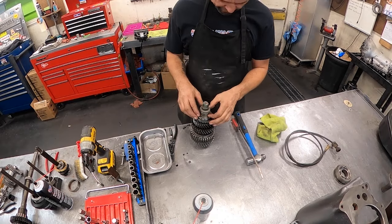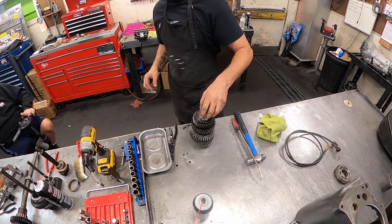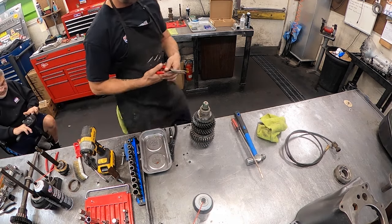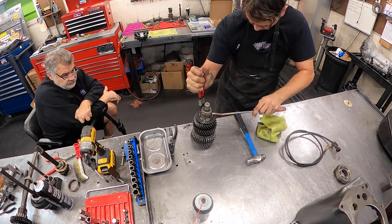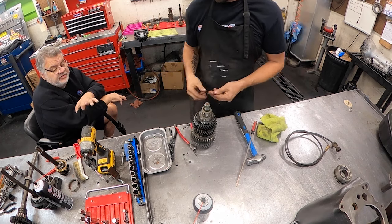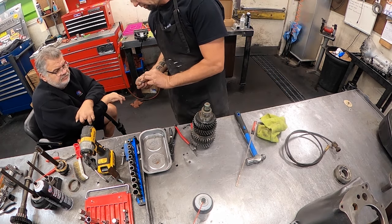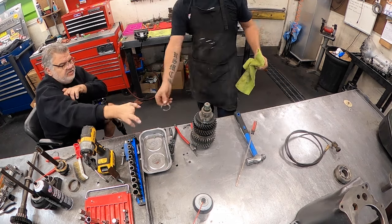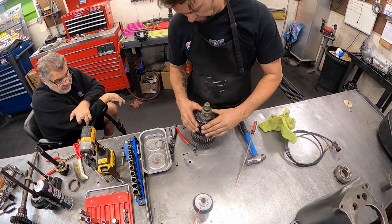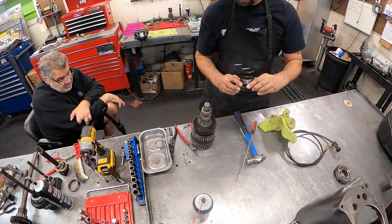This thing's wore out. Did we already try to bust this snap ring off? Holy crap - you can use those. See how this thing was jacked? Look at that - it's all flared out. Slide the gear and the bearing off. There's no bearing in it - runs right on the middle. Keep that in order as it comes out.